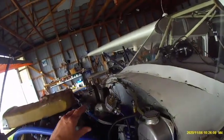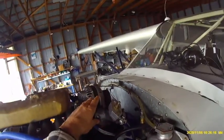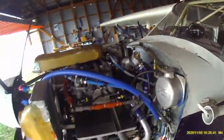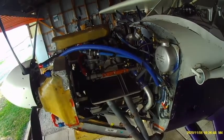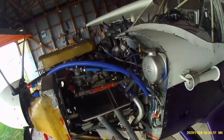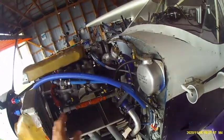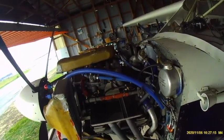Going back over the engine — this is the outlet, and normally there would be a thermostat here, but I don't have one and I don't want one. The reason is I don't trust them — in the past I've had them stick open and stick closed. A thermostat stuck closed in an airplane is a really, really bad situation. The other reason is it's a lot better for aircraft purposes to have the whole engine, heater core, and water systems all flowing immediately on startup. Fluid pumps through the engine block, down through the radiator, through the heater core, etc. — it all flows and warms up evenly.